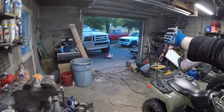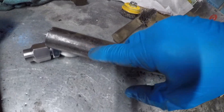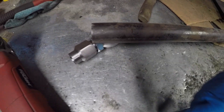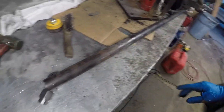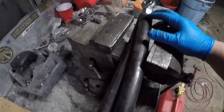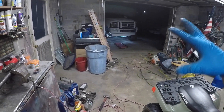I'm just going to run this straight across from wheel to wheel. I've made my mark right here - I need to cut right there - and that will give me the exact length I need. I'll be able to adjust it with the heim joints to fine-tune it, but that will get me in the ballpark. I tack-welded it; I'm not going to fully weld it until I can fit it on the truck and make sure everything length-wise is good.